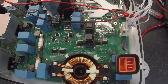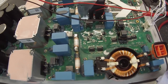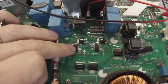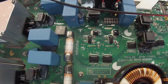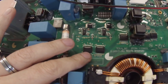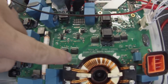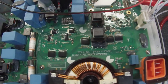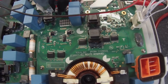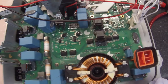Let's see if we can find out where even the DC-DC converter gets its power from. What I have identified is there are two devices here which are basically half-bridge drivers, and there are some more digital isolators here - quite a lot of digital isolators. Nearly all of the devices around this part of the card are one form of isolator or another.